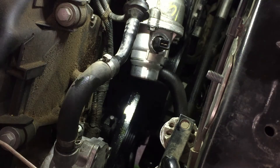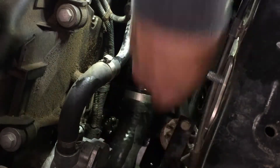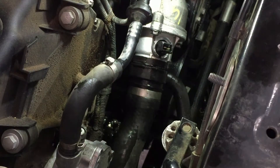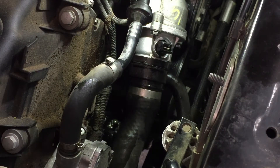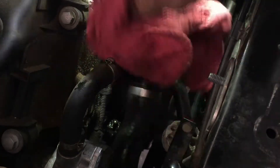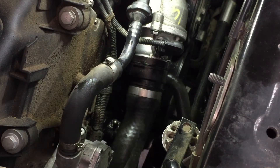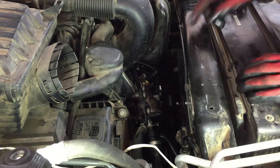Let's snap that hose on there. I did call the customer and told him he had the wrong coolant. Make sure it snaps — you hear that snap, crackle, pop? It's in — yank on it to make sure it doesn't come off. He said it'd be alright, but I do recommend using the blue BMW coolant. It's formulated for BMW and really protects your radiator and water pump. BMW is kind of delicate.